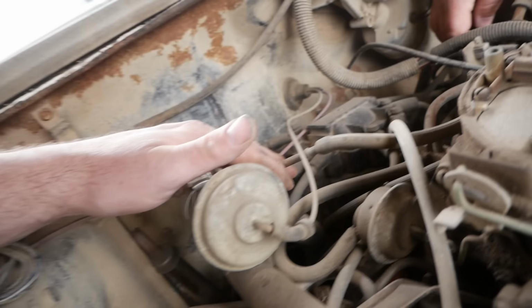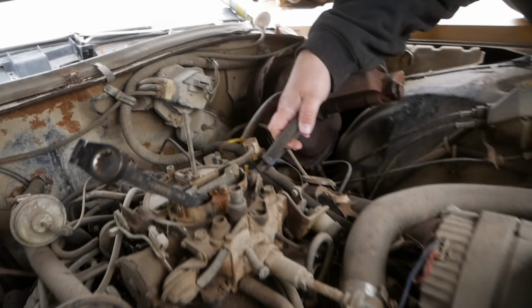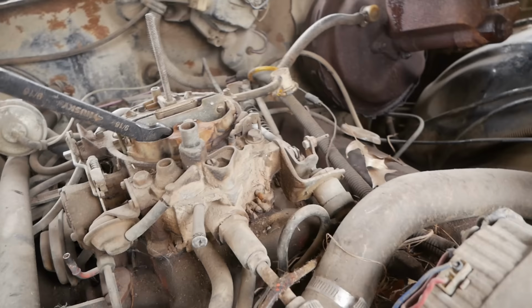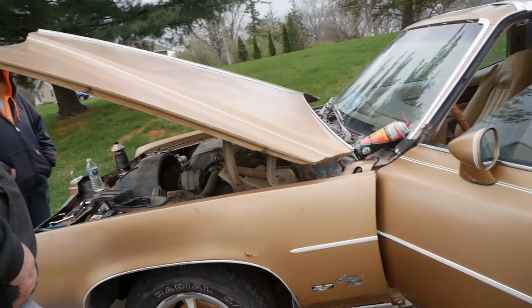Can that go to here? Uh-huh. That's weed eater fuel hose. Oh, don't cut my weed eater line. That is rock hard. It's tiny. Is there a better one? How about this guy? We don't need... That's just the thermostatic choke. It's already plugged. It's plugged solid. It's naturally plugged. Yeah, I think there was an animal living in that. Okay, that may be part of our problem. Sprinkle a little gas in her.